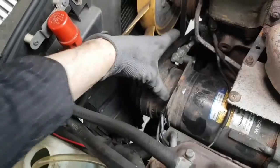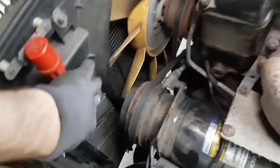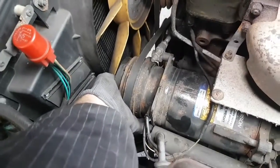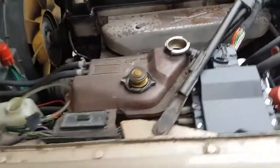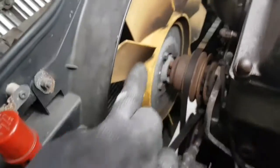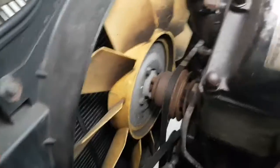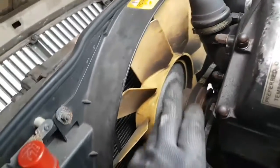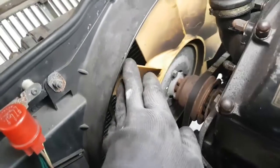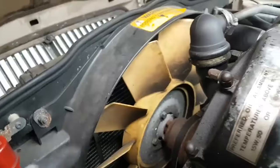I'm hoping that I won't have to take the whole air conditioning off — I'm hoping just to be able to push it over. The problem is, without taking out all the radiator cowling and so on, you can't get to the bottom of the alternator to push it over, so it's quite a fiddle. Because I'm not taking out the fan, I'm going to have to thread the steering pump belt through — but it's stuck behind the fan cowling.